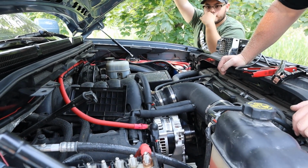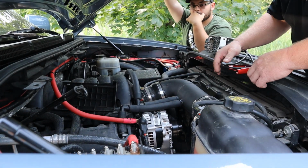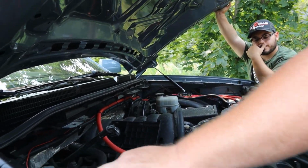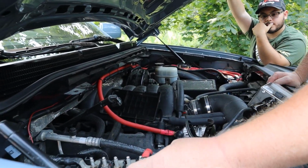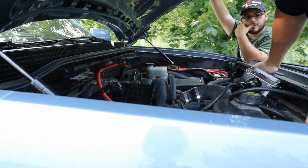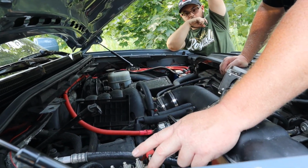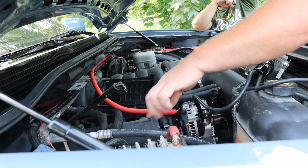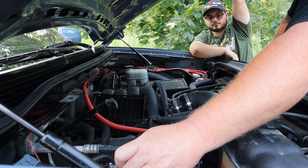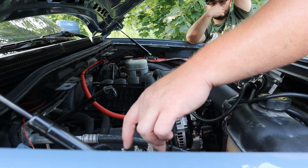Gotcha. Right. And that's what I'm questioning. So there's fusible links here, and this fusible link could essentially be gone as well. Yeah, I'm wondering if, this here is replaceable. If this bolt comes out, these unhook from here, and this whole mechanism is replaceable. But what makes me concerned is all this metal bracket should be close to this voltage, because this lug's coming here. So it almost tells me like this here is bad. That's why it's not going through and going to the other lugs.